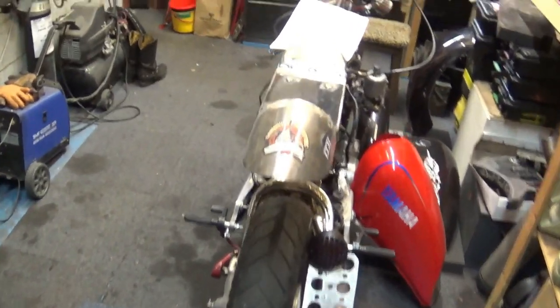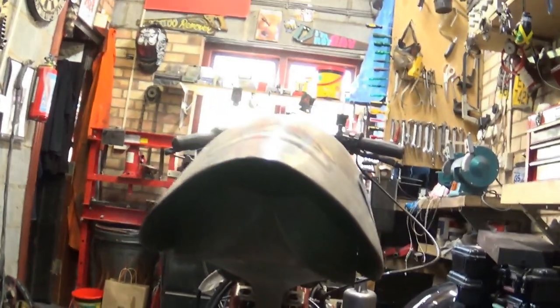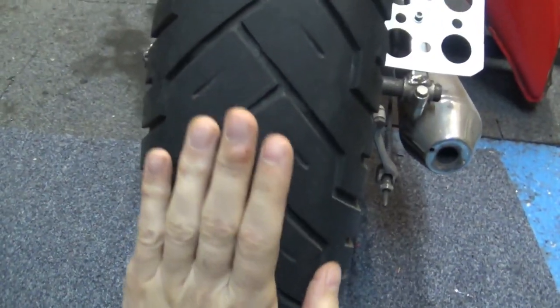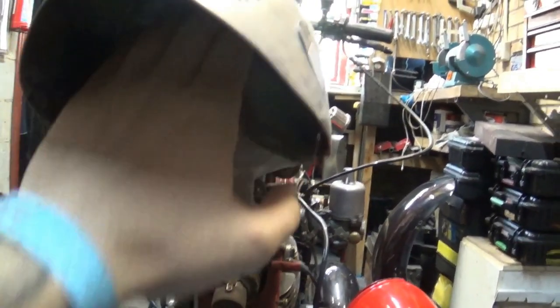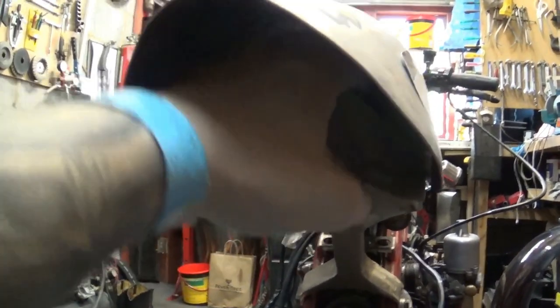So let me show you what I want to do before I take it outside on the road. The first thing is one of the last fabrications — a little splash guard underneath the tail section. As you can see under the tail section there's my subframe, and there's nothing there, so water will be flicked off from the tire, going all the way up and landing in my electrical box. It's a perfect entryway for water to get in there. So I want to create a simple splash guard welded in there so it's not visible from the outside, but protects that little gap.